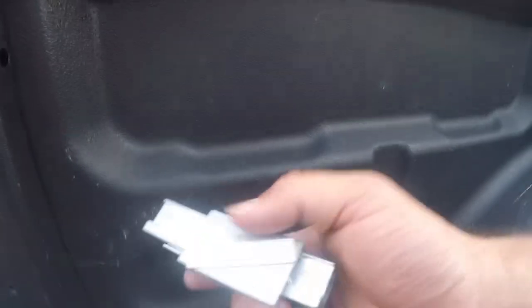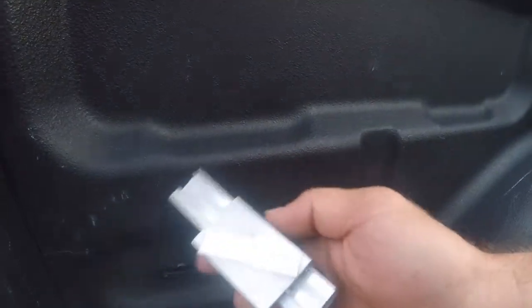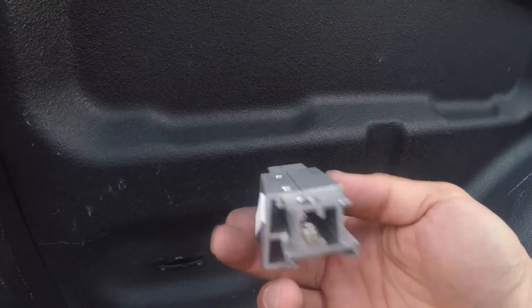Confusing aspects of this is these shims. So that goes against the bed, white is left or driver's side. And essentially, it's going to go up in here like this. There's one little relief area that these can slide in. And then you got to slide it all the way forward to get it in the right spot.